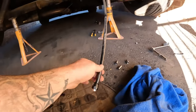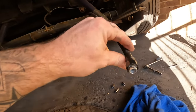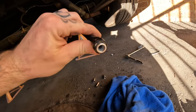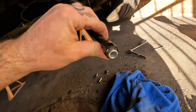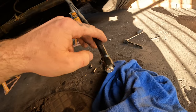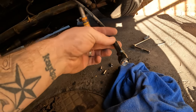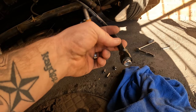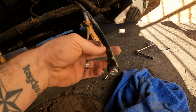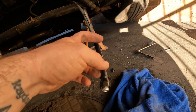The AN line is all detached from the underside of the van and repositioned. I need to pull that olive off, pull the nut off, cut this back a little bit, and then I'll probably just use a new fitting entirely - hopefully that will remedy our little situation. Let's have a go at that and see where we end up.